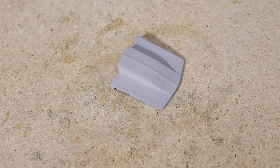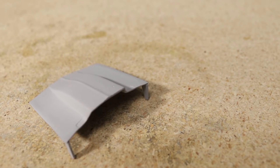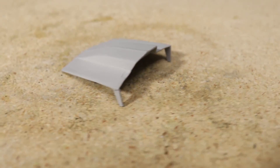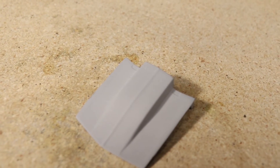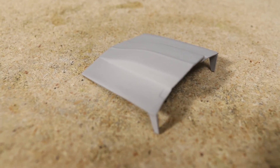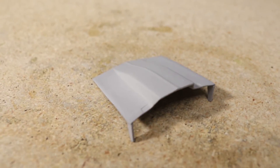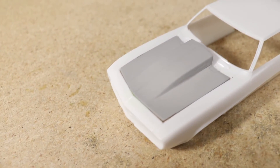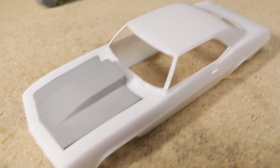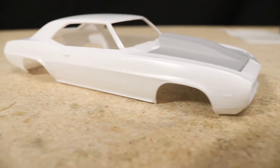This was a really fun little project, and I'm definitely looking forward to making more parts like this in the future. Just making a modified hood like this is relatively basic, though using a similar process it would be easy to make widebody kits or a completely different front end. When you're able to have a scan of a vehicle to work a design around, you're really only limited by what you can design and what can be printed. If you don't have the cash for a 3D scanner, you can build a laser scanner yourself for pretty cheap, and there are open-source software options as well. Prior to the scanner I have now, I built a laser scanner for around $30 and it worked pretty well.